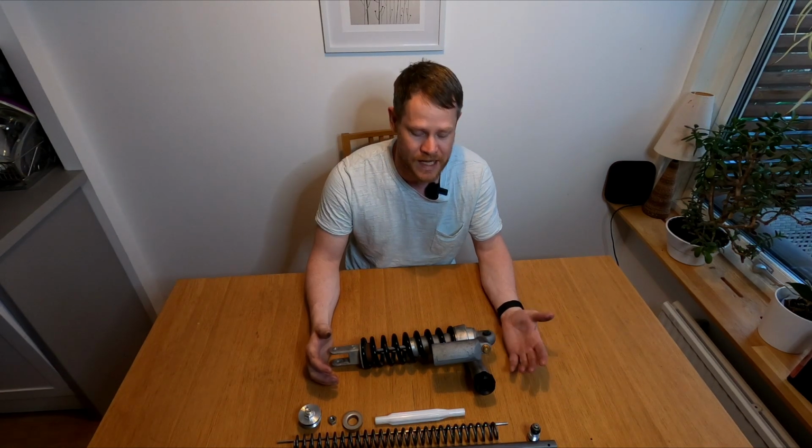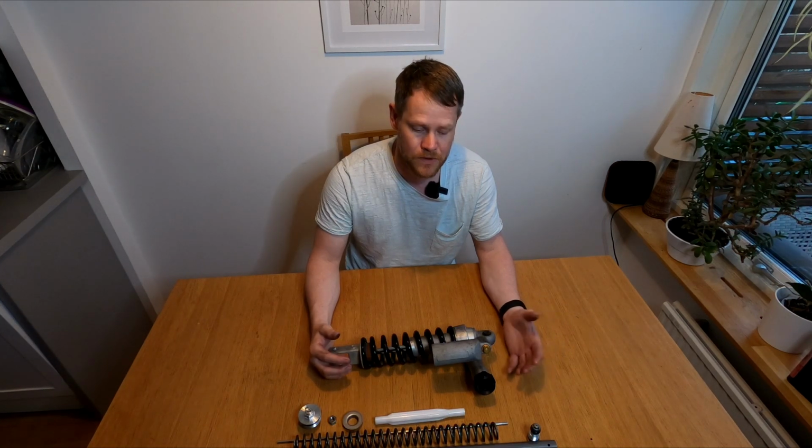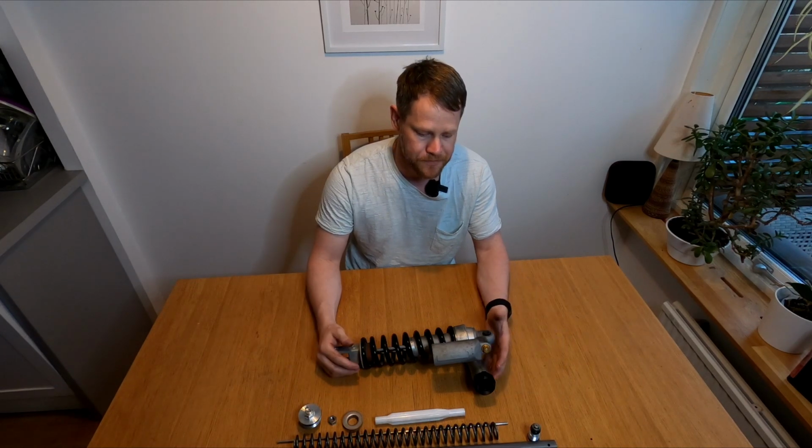So you measure the sag with the gear that you have on you or bring with you when you go out riding. So it's very important that you don't just take your sag measurements once and then forget about it, because it changes. You might eat more hamburgers than I do, and what I did like 2 months ago when I dialed my sag in, now I'm heavier, so I would need to adjust my sag to get the best performance out of my suspension.